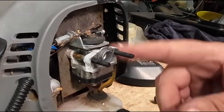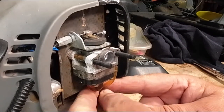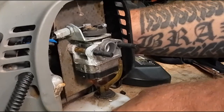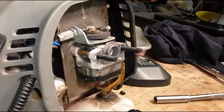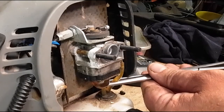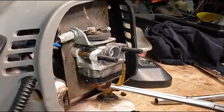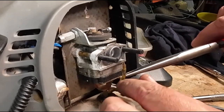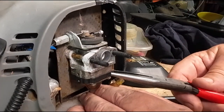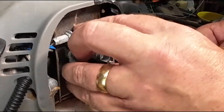So that's all on. This carb is well old. I actually made some modifications a while back — my fuel lines are not excessively worn, which is good. I've tried to keep it indoors best where I can, but there have been occasions when it has been left outside. I clamp my fuel lines off and then get myself a pair of long-nosed pliers. I just want to remove the fuel lines — there's one, and one at the back there. Just a bit fiddly to get in there to remove it.